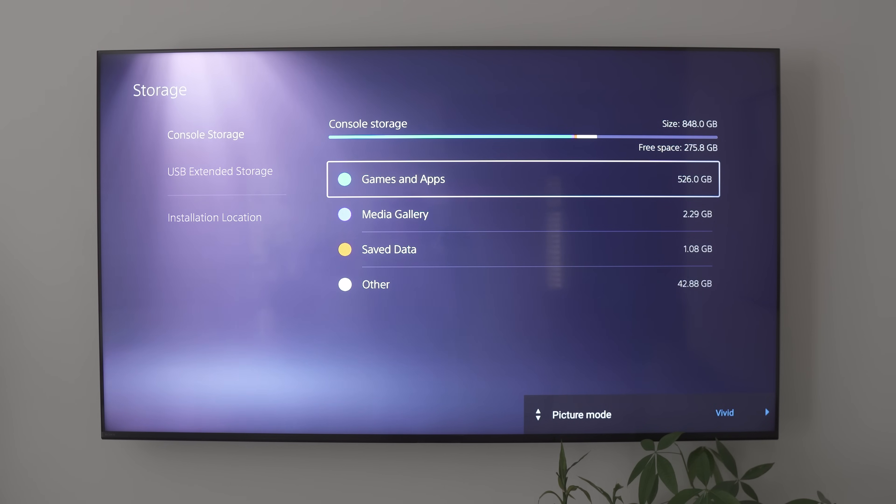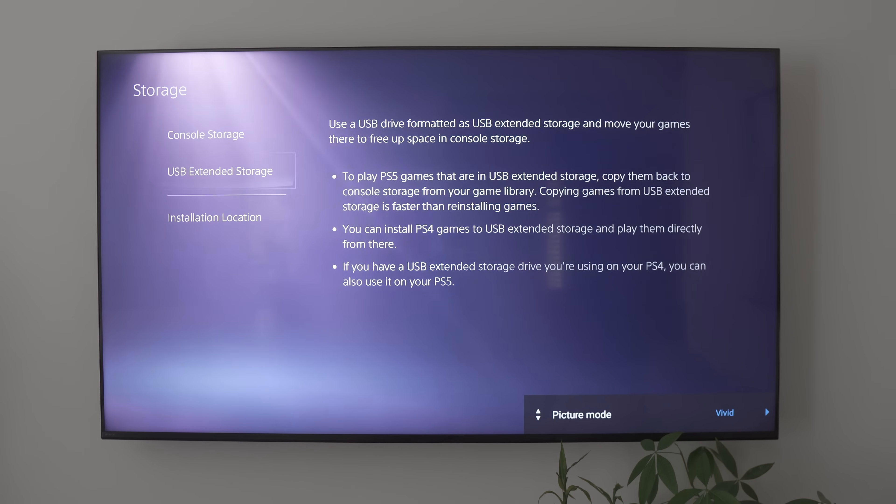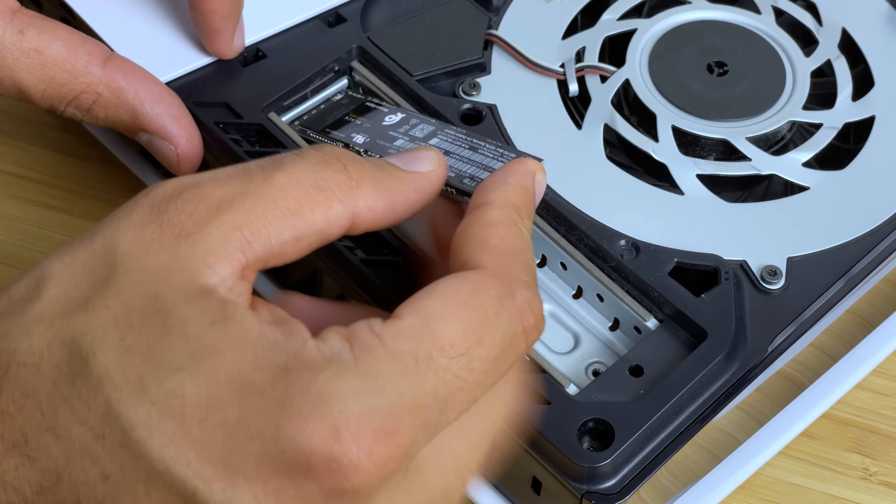In terms of storage, this is where the upgrades really come in. The original PS5 had an 825GB drive where only 667GB was usable. The Slim has a 1TB drive where about 825 to 848 gigabytes is actually usable — roughly 150GB more storage. You still get an expandable NVMe slot, so you can expand storage whenever you like. All you need is an M.2 drive, pop it in and it will format, and you can save games to that drive. Just make sure the read speeds are at least 5,000 megabytes per second — you don't need a Sony-licensed product, but read speeds matter. I've made a video on expanding storage; I'll link it in the description. It can be done in under three minutes.